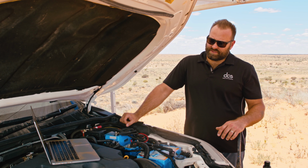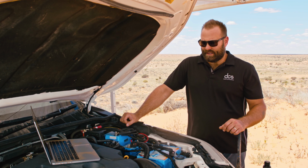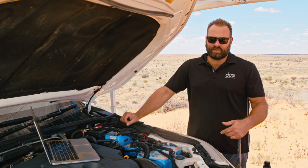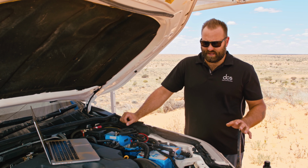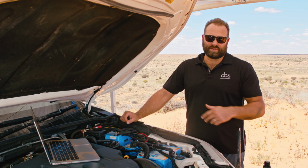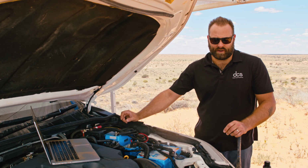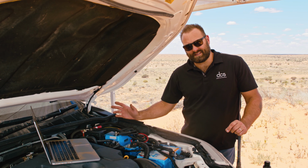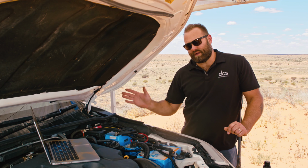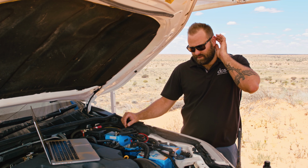So you don't need to run a third battery. It's just completely unnecessary. But if you have massive power demands and you believe that you want to install a third battery down the track for whatever reason, all you do is install that third battery in the back, if it's a 75 or a 90 or a 100 or an 80 or whatever, or it's one of our slimline 100s or 150s or 200 slims, and you run that through, for example, a Victron DC-DC charger, okay?